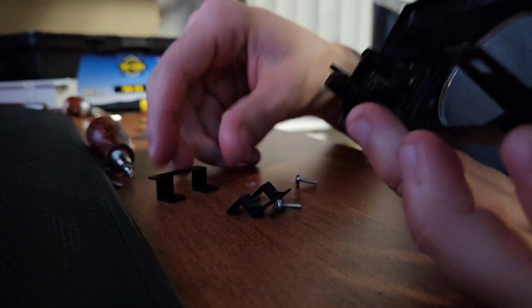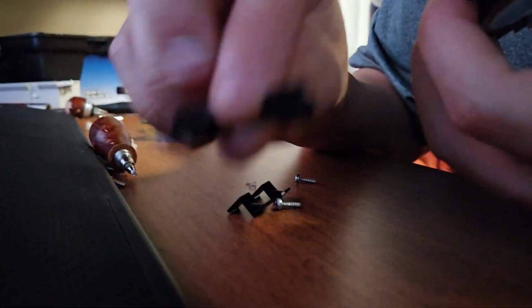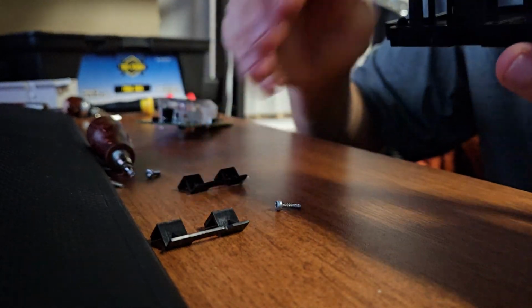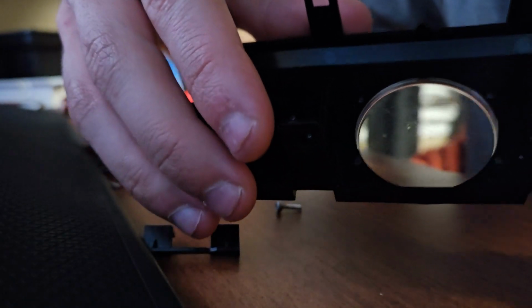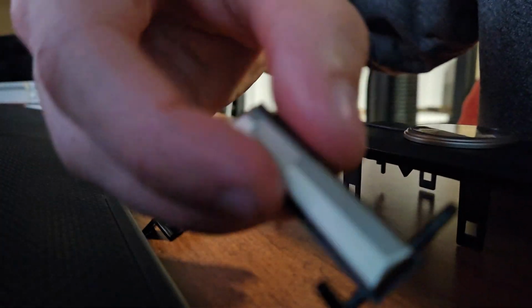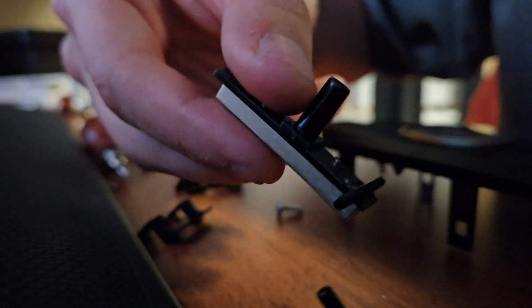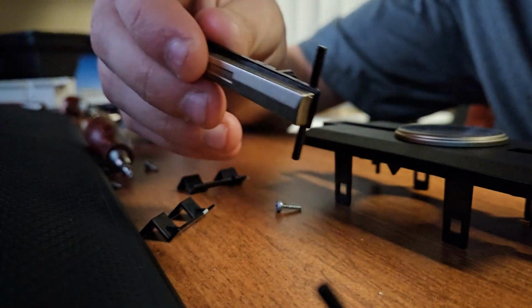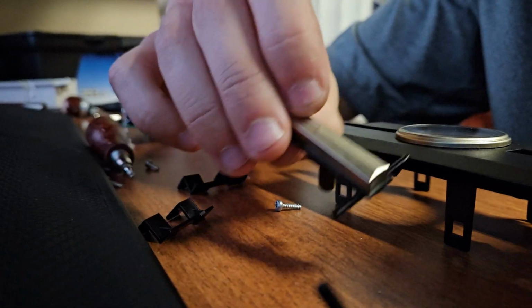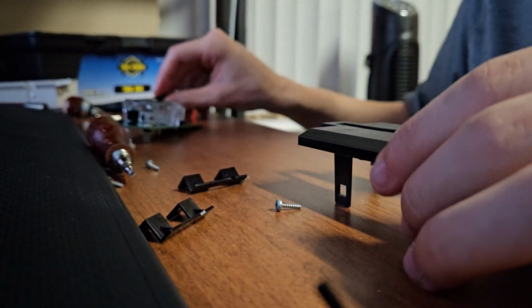Now that those are out, these plastic brackets that I was talking about just come right out, and they fall out along with the screws. Now that that is hopefully stopping it, these things will, oh, it looks like they do. They come right out. So there's how to remove the buttons. So these are not plastic melting into place. So you will be able to replace these if you have another junk one that you find that has the better buttons at a junkyard.